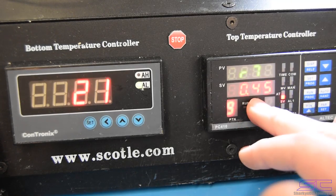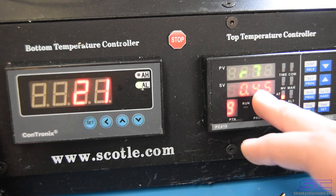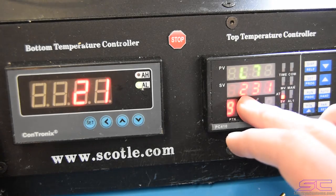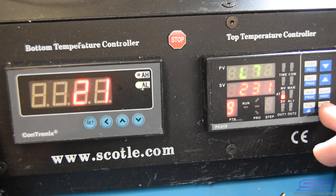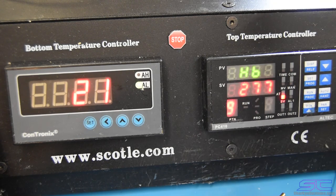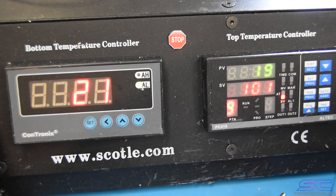And R7, I think I have 2 more settings after, or 2 more settings including this one, and that is just to be sure that the solder has melted underneath. I just added this extra option just in case, you know, it's being stubborn and it doesn't actually melt. So all of those profiles are gonna be in the description.